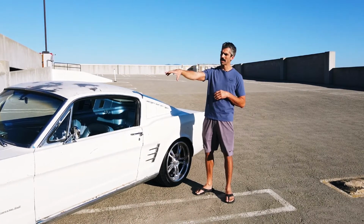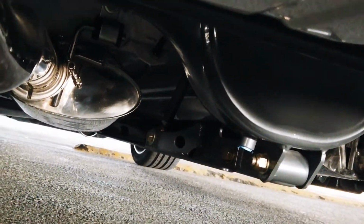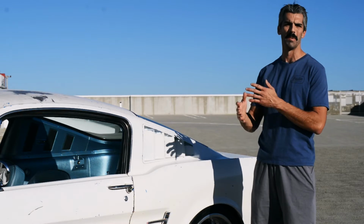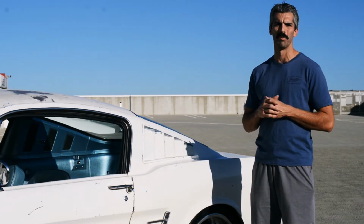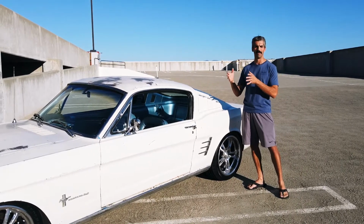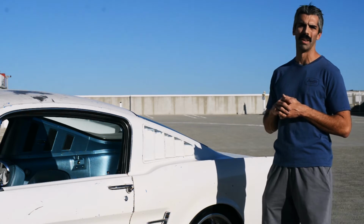With that being said, the whole kit, front and rear, we did the TCI independent front suspension with the 3-link torque arm in the back. Additionally, that torque arm kit came with subframe connectors and a drive shaft loop, and all that stiffened up the car dramatically. Basically it takes the structural supports from the rockers down to an actual frame in the car instead of just from the rockers and stuff. So definitely stiffened it up. The car drives awesome, it handles awesome.